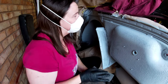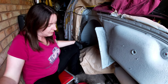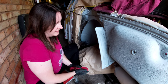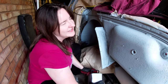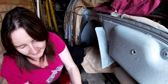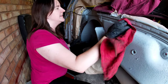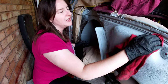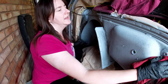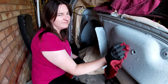Try and protect my lungs a little bit if I can. Now I've finished scuffing it all up, we now want to use the degreaser. I've got this degreaser, or panel wipe, just to make sure it sort of helps keep all the dust out of it. Not that it really matters under here, because we're not looking for a good finish - we're looking for good contact, basically. We want the paint to stick and stay stuck. Because if you don't do all this prep work, the paint will just fall off again. You don't want that.